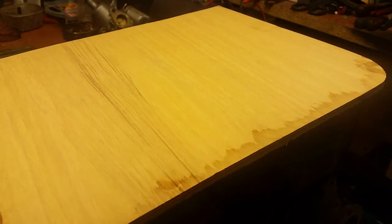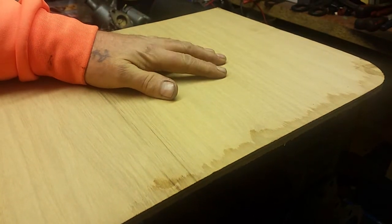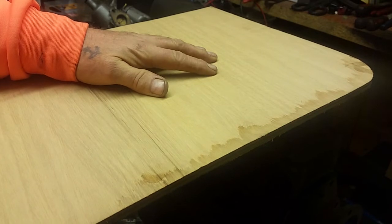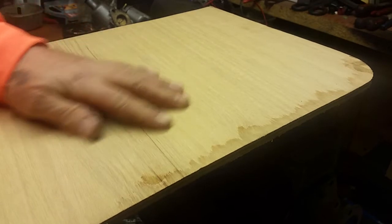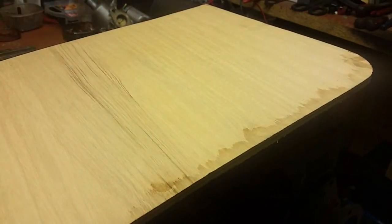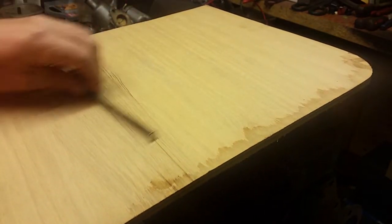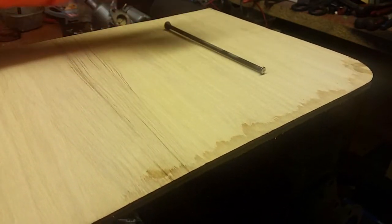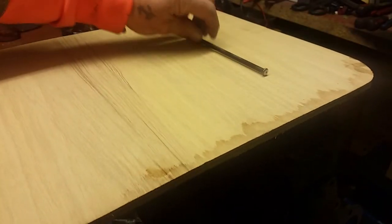Right, what I want to show you now is a flat piece of board. I want to show you about checking your push rods, because this engine was seized up when I bought it and I can assume it's bent one of the push rods. I want to show you how easy it is to check whether your push rods are bent or not. So this is one of the known good push rods - you can see it rolls down there quite easily, it's not making any unusual noises, rolling nice and steady. The board's only barely tilted.